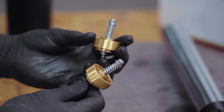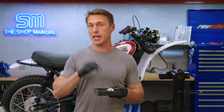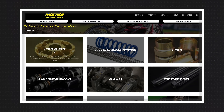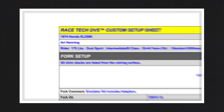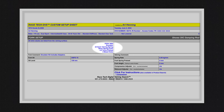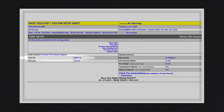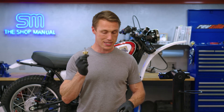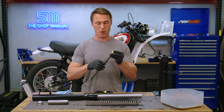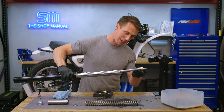The emulators come as a kit with extra preload springs and valve plates and need to be set up. When you buy them, you get an access code to Racetech's valving website — you put in your bike, riding style, and weight, and it spits out custom specs not only for the emulator settings but also recommended spring rate, oil height, and oil weight. Once you've got everything set up on the emulator, put them on top of the damper rod, make sure your top-out spring is over the damper rod as well, and you can start reassembling.